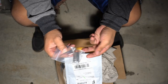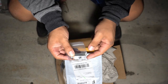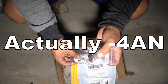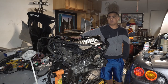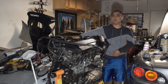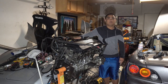The way I'm going to supply oil to the turbo is with this little adapter right here. It bolts up to the same location as the stock oil pressure sender. The oil pressure sender goes right here, and there's a little port where I can attach a fitting that goes to a dash 6 AN, which attaches to the Rally Road oil feed line that goes straight to the turbo. A common solution is to feed oil from the VANOS banjo bolts, but I decided against that because when VANOS activates you do lose a little bit of oil pressure, which I don't really want to risk with this turbo.